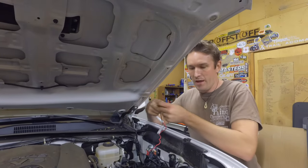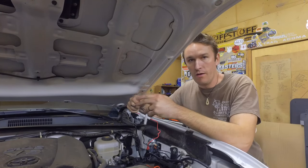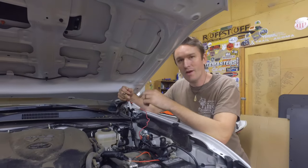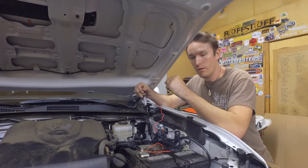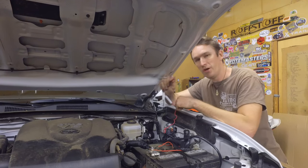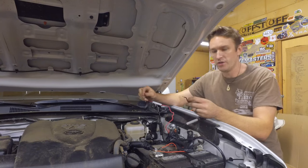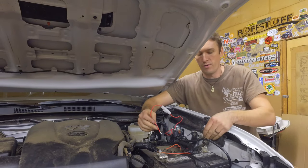Once the wiring is set up, we're not going to run the switch right now because Juan's going to get a Switch Pros or S-Pod later on. You're able to leave it that way because there's no power going through everything — it's only going from the wire at the terminal to the solenoid. But we can jump them to make it act like a switch is there, and you should be able to hear the solenoid click on to know we're getting power.